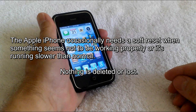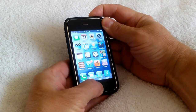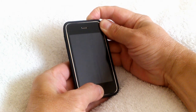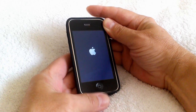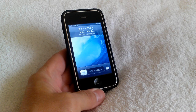What is nice about a soft reset is that it does not remove any apps, songs, contacts, or anything else that's stored on your iPhone. To do a soft reset, hold down the power button and the home key both at the same time. That powers it down, then it will power back on and you'll see the Apple icon come on — between 10 and 20 seconds on average.